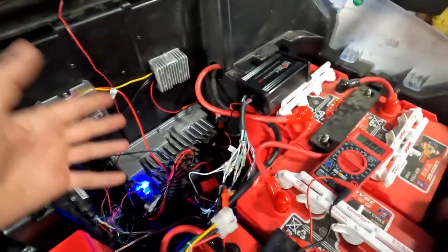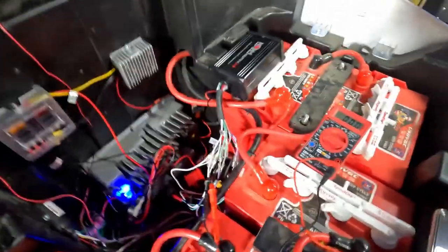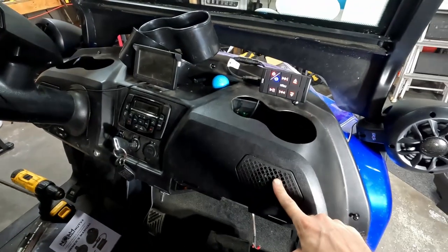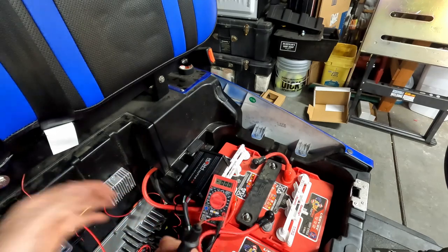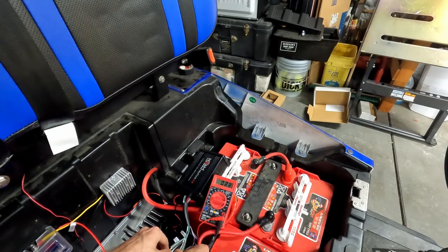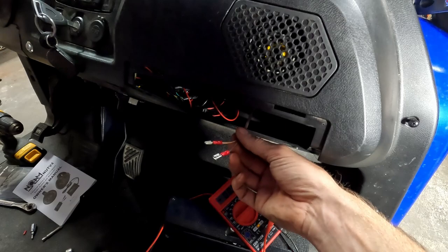So I've got it all hooked up, got it playing — sounds great. I decided to test how much power it was pulling and found out it was only pulling a couple amps, so I went ahead and pulled the big blue fuse out. The little guy right here is just enough. But that's when I noticed I've got sound on the dash, but no sound out of this one speaker. Now we've got to figure out why I don't have sound out of the one speaker. I'm not sure how well you can see my multimeter here — I unplugged all the speakers. We're going to test each one with the multimeter and see what connections are bad and why it's not producing sound. I've got power on this one, so it's channel 3 that's not working. I've got power from the amp, I'm getting signal from the first connector, but the speaker connection is nothing. Brand new wire — can a brand new wire be bad? Let's test another wire.